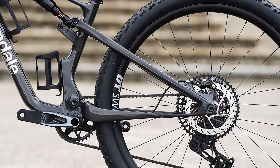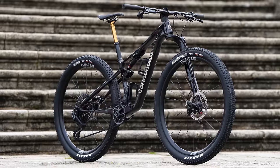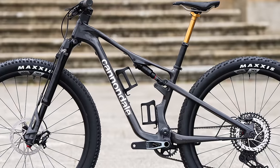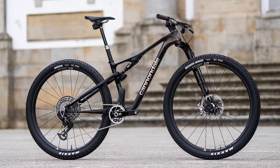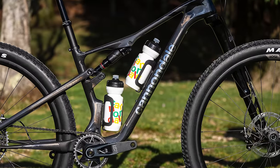In terms of the bike shape, not only are the chainstays longer than before, ensuring that the geometry is balanced, but they also vary with bike size too. Additionally, Cannondale has steepened the seat angle by a degree and slackened the head angle by around 1.5 degrees, making them 75.5 degrees and 66.6 degrees respectively. Reaches have grown 10 to 15mm for a given size, with a size large measuring 475mm.